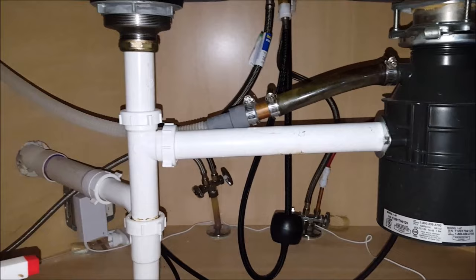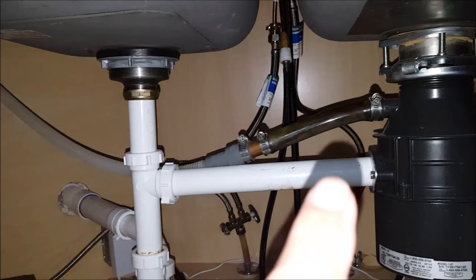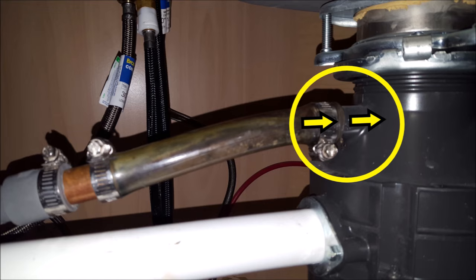The next step is inspecting the drainage hose for possible blockage. One end of the drainage hose connects at the bottom of the dishwasher, and the other end usually connects under the kitchen sink with the drainage pipes, or if you have a garbage disposal it will connect right to the side of it. Regarding the garbage disposal — if the garbage disposal was recently replaced and your dishwasher is not draining, then more than likely the knockout plug inside the hole where the hose connects might need to be knocked out with a screwdriver and a small hammer. This will allow water to flow through the inlet on the side of the garbage disposal. If the disposal was not recently replaced, this should not be an issue.